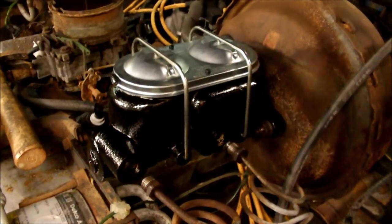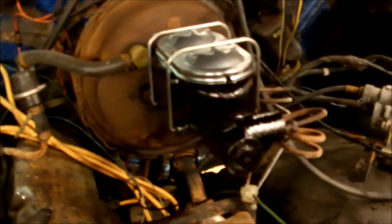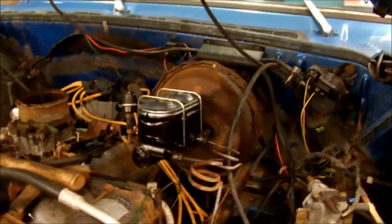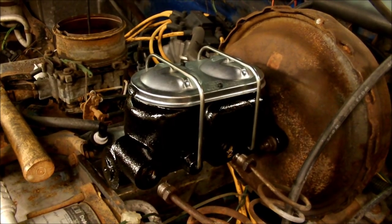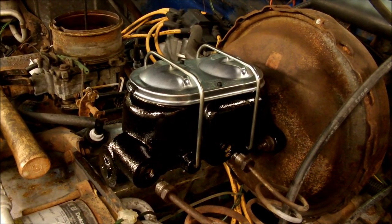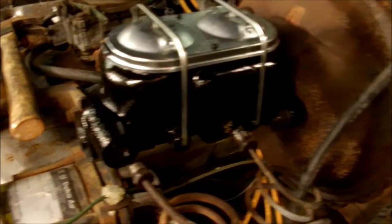There's the new master cylinder on — well, for the most part, I just bolted it on. I gave it a nice coat of gloss black spray paint so it doesn't turn into a rusty pile of crap after a week when it starts flash rusting. I'm not going to cover bench bleeding here. Before you do anything, you have to bench bleed the master cylinder, which involves putting it in a vise and pumping the fluid through it to get the air out of it. But I made an entire video which goes completely in-depth into bench bleeding, so you can go watch that — I'll put the link in the description. After it's bench bled, you just put these caps back in to keep the crud out.